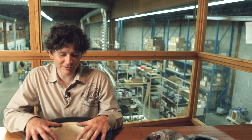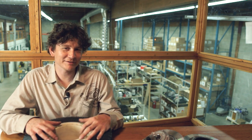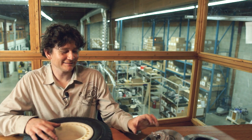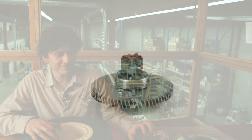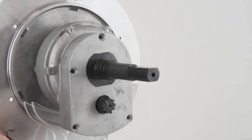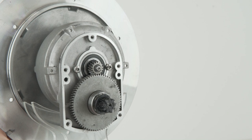Because there's quite a bit more internal space inside this hub, Bafang had a lot more room to be creative in how they achieve the gear reduction — in this case with just an offset jack shaft. The motor itself is the same internal motor as the G311 bike hubs, but it's spinning a two-stage gear reduction.